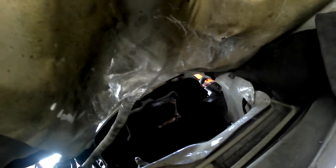I've tried pushing the exhaust through here and it won't go through. What I'm going to have to do is remove a bracket here — it's got three 13mm nuts on this side and a 10mm nut up there. I'm going to take this bracket off and it should give me a bit more clearance to get the exhaust through. Let's undo this and see if that works.